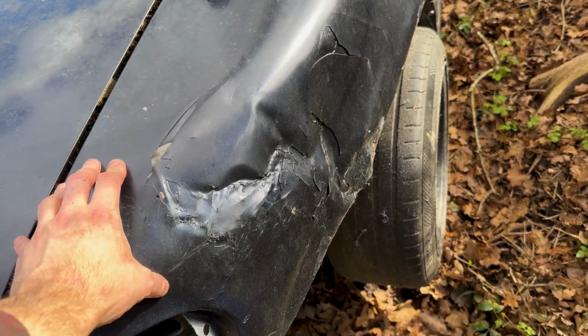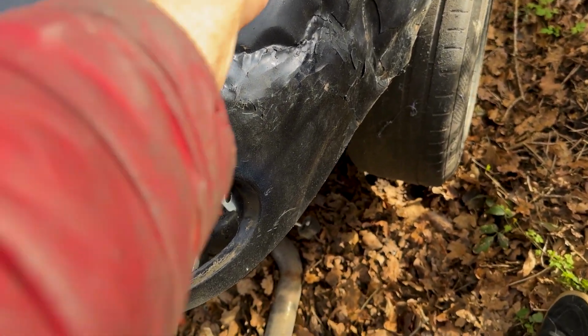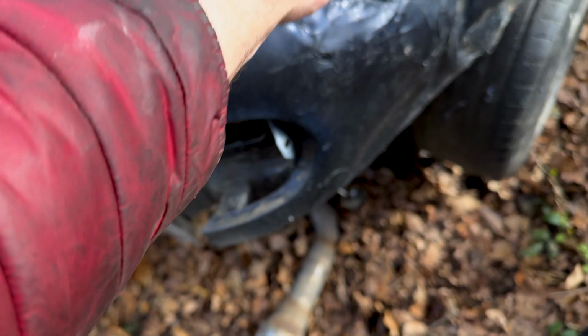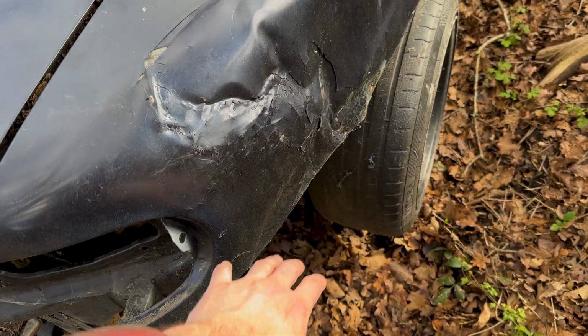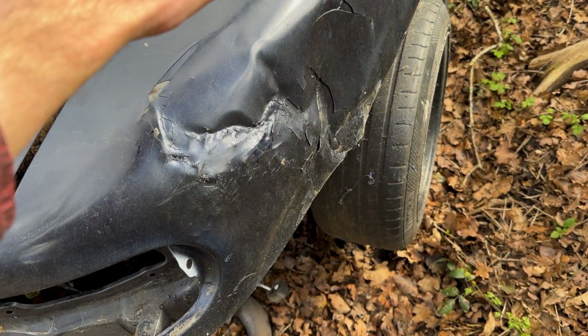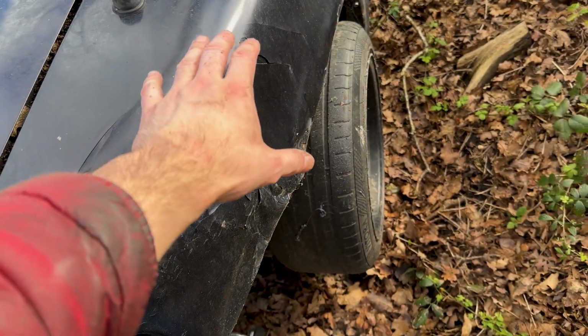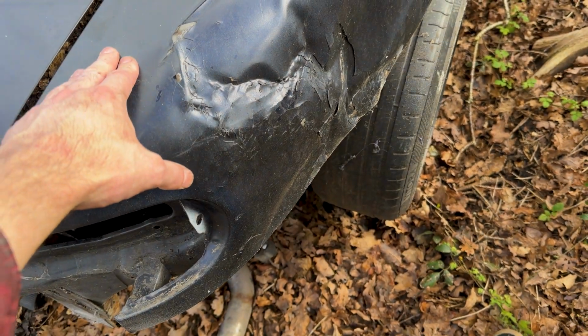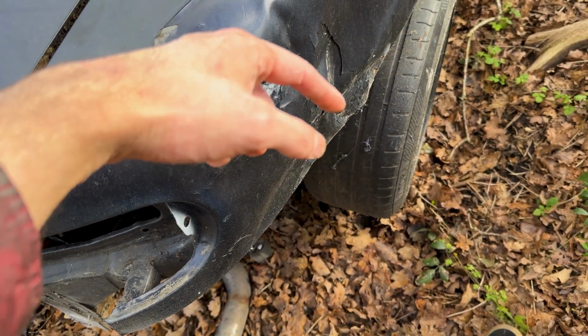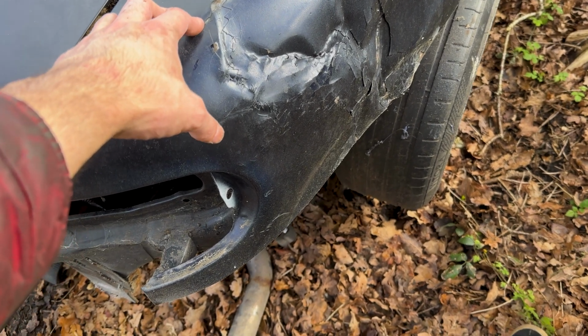And then dealing with this quarter, this dent here. So I have two ideas for this quarter. Let's go 0.5. Oh, we can't go 0.5. Two ideas this quarter. Either fill it, smooth it out, make it look nice, or cut it out and find someone breaking a car so I can get that cut segment out and then weld it in place and clean it up.